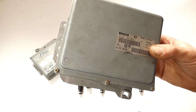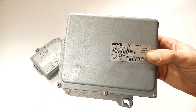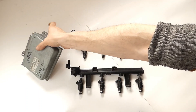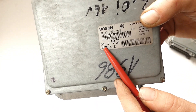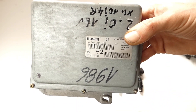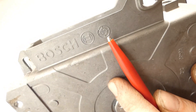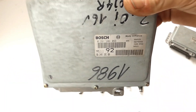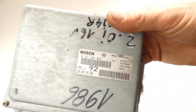Very importantly, when you get the new ECU it must be unlocked - the immobilizer must not prevent it from working. The older models were relatively easy to unlock; the newer ones need the immobilizer deactivated, and not everyone has the means to do that. The new replacement ECU also has data version MP5.1.1 - here is the number for it - and from 1995 it is compatible, since this engine first appeared in 95. It is compatible with the wiring harnesses from a 96 Xantia or a 96 XU7 JP4.